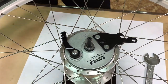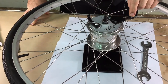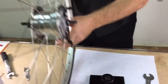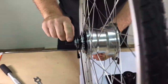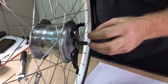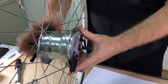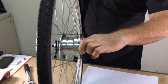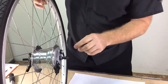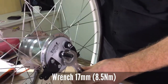If the wheel is new on a bicycle and it's never been installed before, the angle adjustment between the axle and the brake anchor will need to be done on the bicycle. Bolt the wheel into the bike with the non-turn washers and axle nut on the right side. Install the washer and axle nut on the left side, tighten the right side down to hold the wheel in place, then adjust the chain and install the coaster brake strap and bolt.